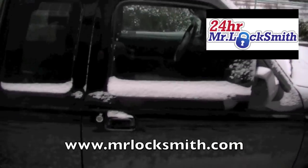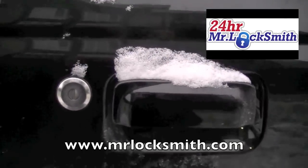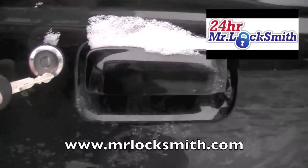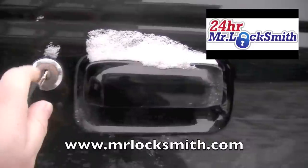If your door is really frozen then you have to apply heat to the entire door to get it open. So take a look at this short clip and I'll show you how to put some lock de-icer in your car. Here we have a nice cold snowy day. Don't pour boiling hot water on this — you just make it more difficult. Get the dust cover out of the way, put your key in, and just spray.